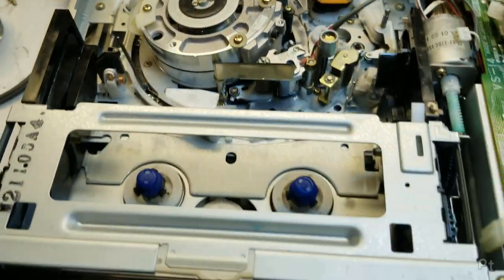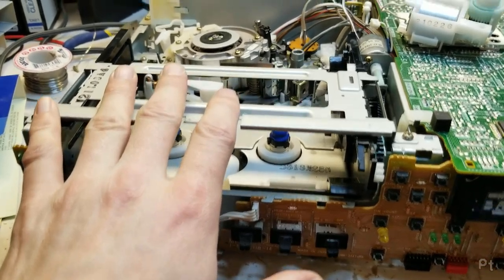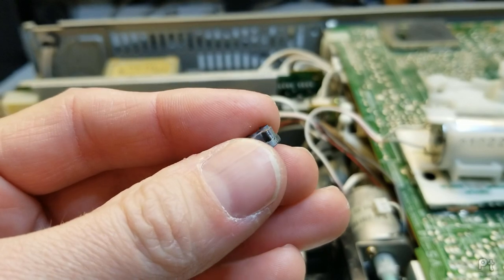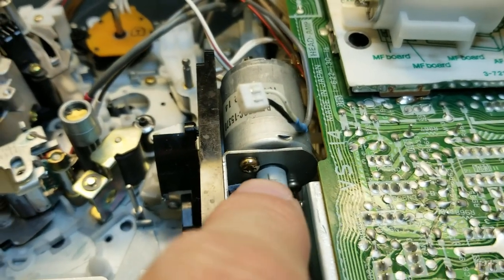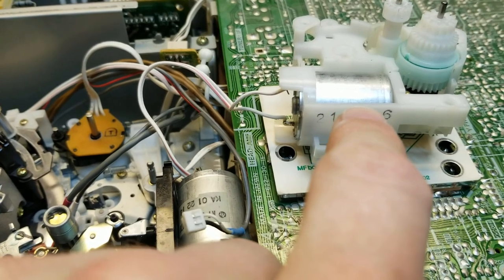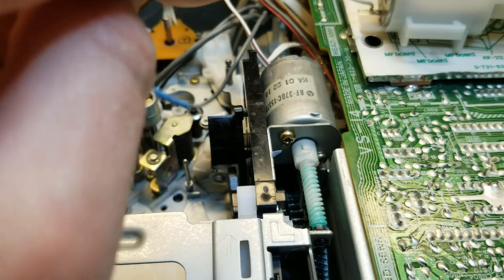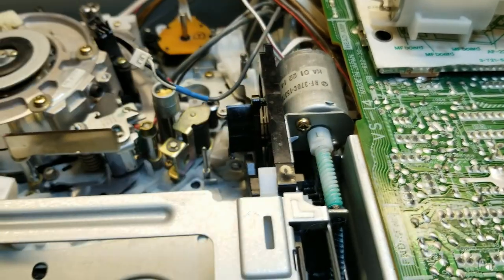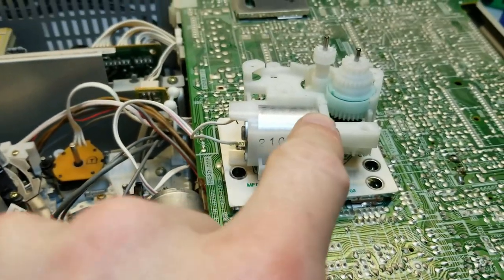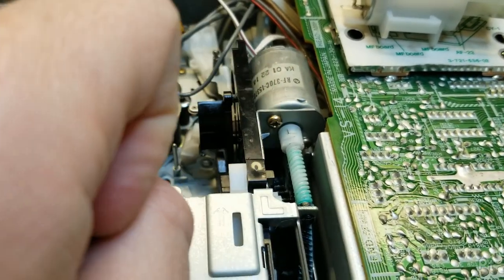Not completely going to waste — this front loading mechanism is going on one of my 860Ds. And I'm going to see if this gear cog thing that I printed off is the same size on this motor. I notice this one is starting to slip, just like both 860Ds — just like every one of these that I've ever seen. And I may just try putting the collar that I printed on there, or try putting a whole new cog on.